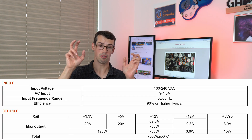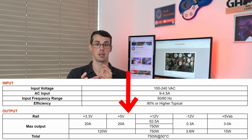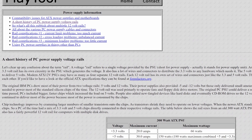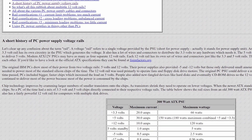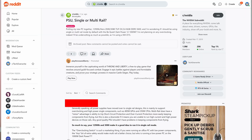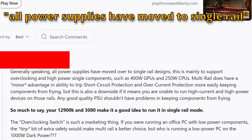When I first started building computers almost two decades ago, pretty much all PSUs were multi-rail — they had different lanes inside of them that would deliver power according to different voltages. You had the 3.3 volt rail for things like the RAM, and then another rail would deliver at 5 volts for things like hard drives and optical drives — so they could read data from those big shiny round metallic disks, without needing to download so much data from the internet. I'm not old, you're too young. Then you had a main higher-power 12 volt rail for things like the CPU and the GPU. But over the last decade or so, many PSUs have actually moved over to be single rail, delivering everything on a 12 volt rail.